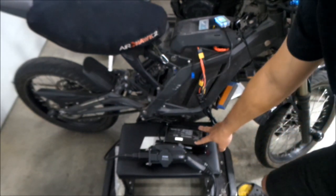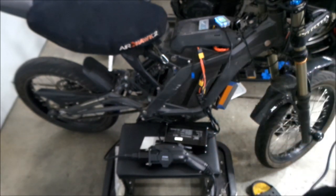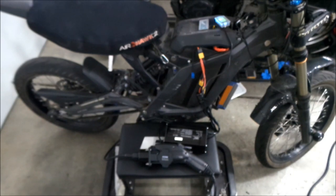So this charges at 10 amps. I think the battery is roughly 30 amp hours, so 10 amps should take 3 hours. It would take 3 hours to fully charge a battery from fully discharged, okay? Let's hope by the time you get to Rubicon Springs you don't have a dead battery. I'm pretty sure probably not. You'd probably be close to dead, but not really. And you can probably complete the trail.